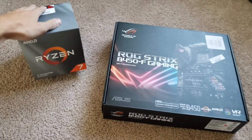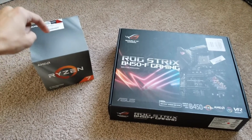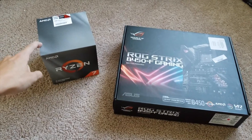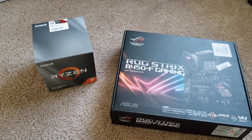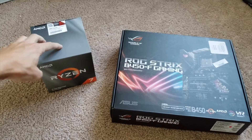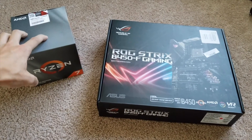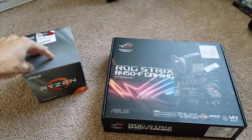Keep in mind, this was pretty late at night. So the next day, I took the fan off, popped out my processor, took it back to Micro Center where I bought it from, and returned it to get a brand new one. I told them the fan was not working right, and they exchanged it out for me. I brought it back, put the new CPU in, put the fan on top. It took a while to boot up because I stuck a new processor in it, but once it booted up, it gave me the same exact problem.